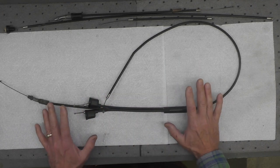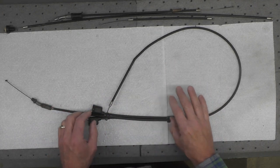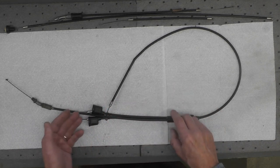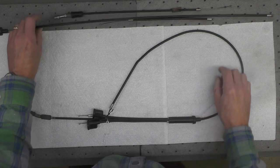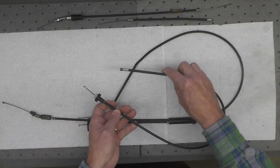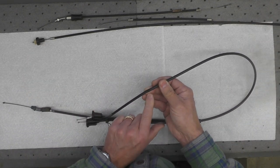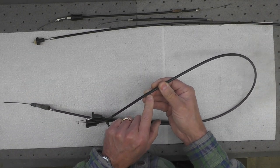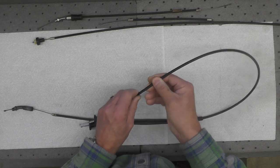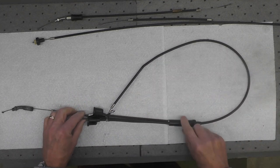I don't need to replace all of these parts — I previously inspected them quite some time ago. I am going to replace three of the four separate cables. I am going to replace the cable that comes down from the twist grip; that is the new NOS part. The reason being is the original cable has an abrasion in it — you can see right here where it has been abraded over time. So this cable is going to be replaced with NOS.